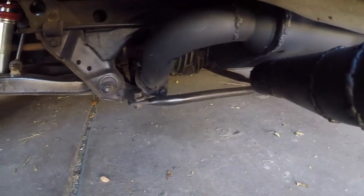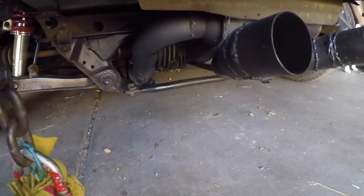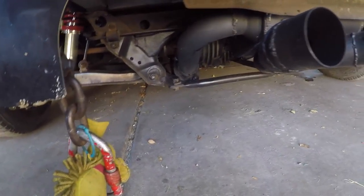The exhaust is supposed to be way over to the side like that, so I may just need to bend the hanger tabs over. It just shouldn't be that close. I need to bend the rear hangers over more so it pulls the whole exhaust towards the passenger side a little more and gets it off of there, because it's super annoying. Hopefully I can get that done.